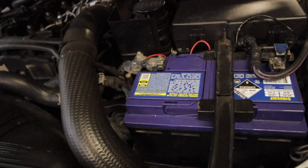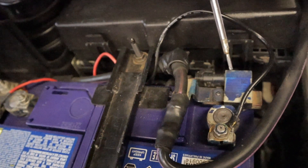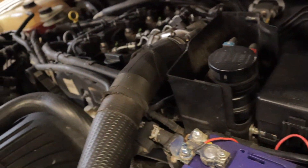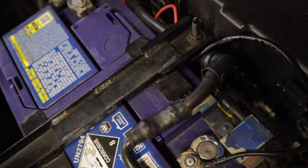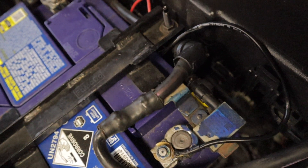I'm going to show you how to disconnect it manually. You come over to the battery and there's a little box here — this is the module that controls the amount of voltage, sends a signal to the computer, and it regulates the voltage sent from the alternator to the battery. To disconnect it, all you do is push down on the little tab at the back and slide it back. It doesn't have to come all the way out — as long as that contact is separated inside, that's fine.